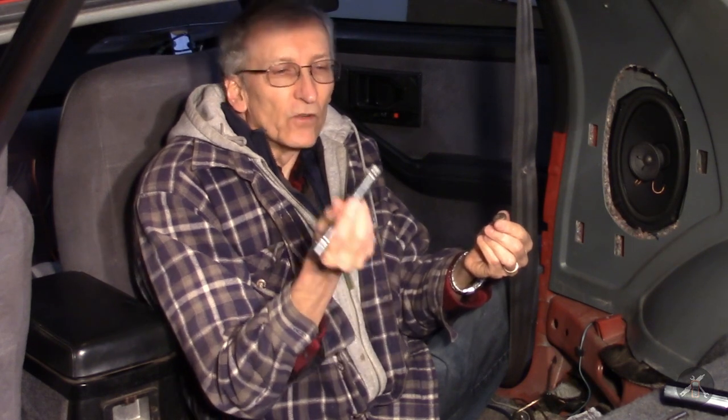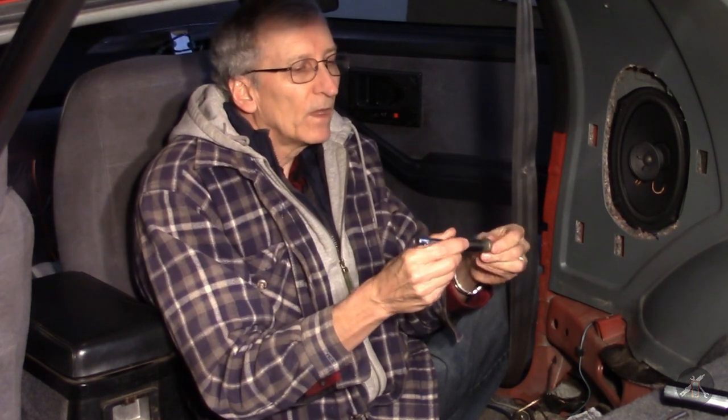But when I was working on the car, I didn't have it with me and didn't try it. So I went back searching online for the right tool, because Torx has a number of series, and there's one they call Torx Plus. A standard Torx 50 is a T50; if it were a Torx Plus, it would be called a TP50 in their parts list. I searched all over and they're not real common.